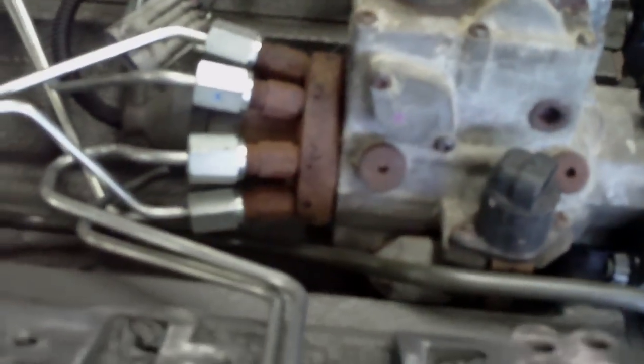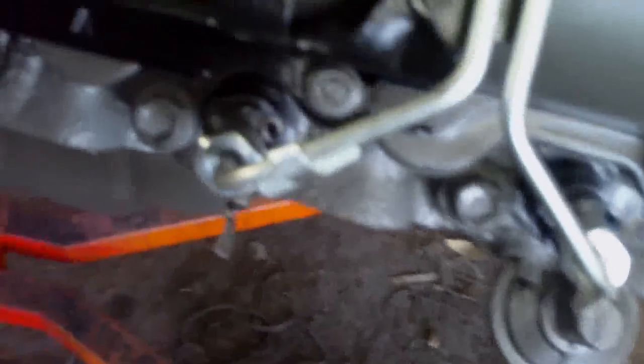But I didn't actually know in the beginning. What I had to do was — I actually went with number 6, I believe it was. I found my number 6 line. These lines, happily, have a little serial number on them that you can see. And the final digit of the serial number is actually the cylinder number. I found that one, noted where it fit best, and it was probably a pretty good choice because there was no way it fit in this position, and there was no way it fit underneath.